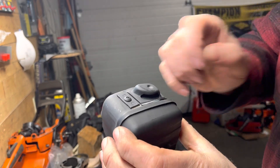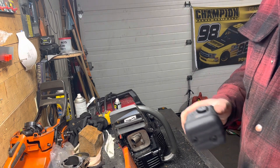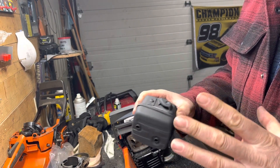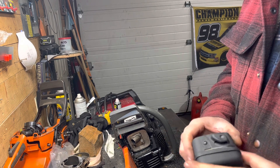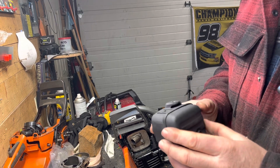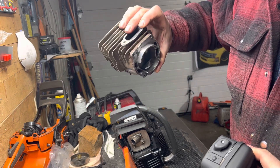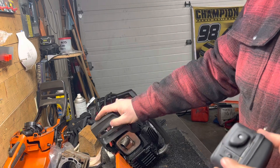There's another thing that comes up: spark screens. These are required to be in your saw normally if you're going to be working within a certain distance from a provincial or state forest or crown land, in case a fire starts — or in an effort to reduce the potential of a fire starting because of hot pieces of carbon that can blow out of the motor.